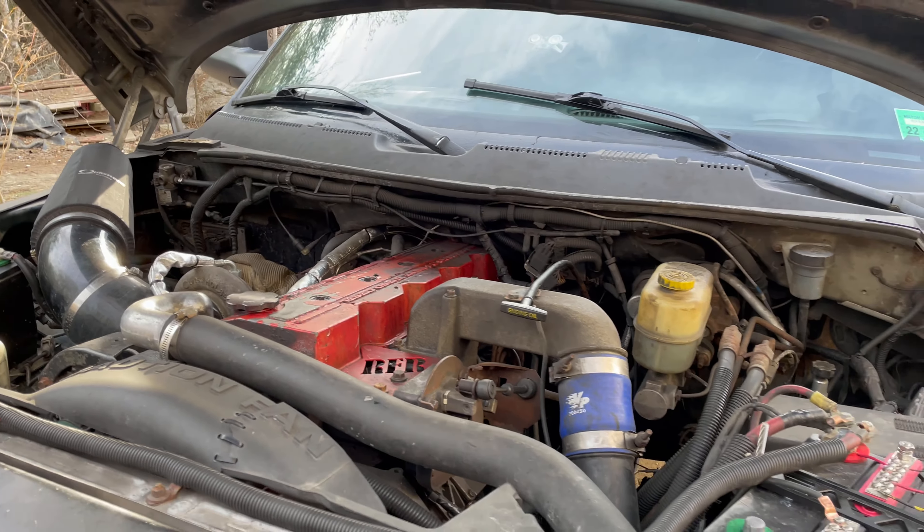I can't figure out the damn brake light issue. I did all the grounds, I cleaned everything, they're still stuck on. Some people told me it could be the brake light switch, so I called O'Reilly's and they got one there for 20 bucks — definitely going to go try that. This was me walking out of O'Reilly's with our brand new brake light switch. We weren't having issues at the time, and then I went and gave the truck a wash and went home.